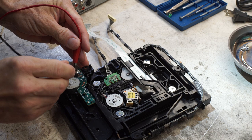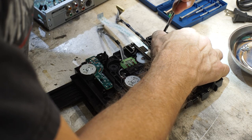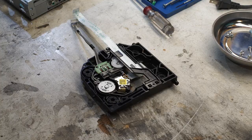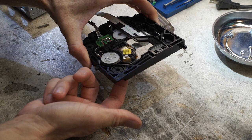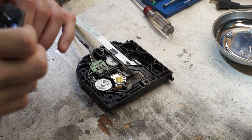Let's go one more step and take this carriage out. There's the problem right there — our motor. Almost certainly the brushes inside the motor are shot because it's getting no continuity no matter what. It's not going to hurt anything if we spray some contact cleaner in there and just see what happens, so let's do it.